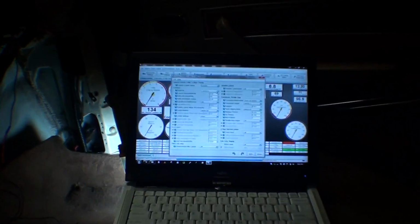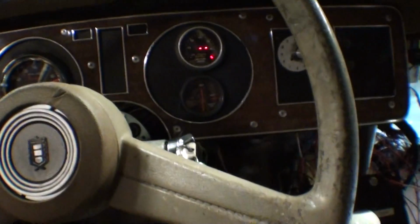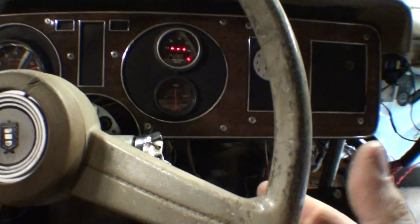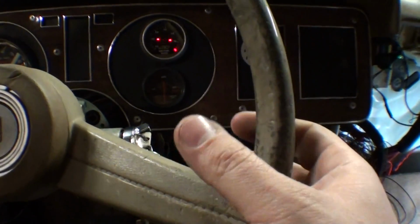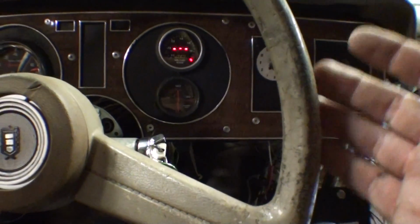You can change the way all of that works, obviously, but that's really cool to me. You have to press it and let go, press it and let go. Now, if you have it set up pretty short, you have to understand, it might take 3 bumps for you to get in. You could set up the car so that it goes 6 inches, I think, from first stage to second stage in 1 bump. Here's the issue.